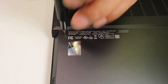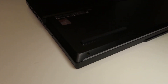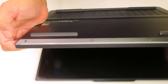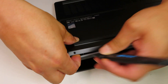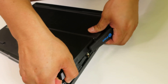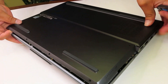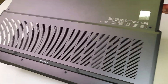Now I'm going to start from the bottom side of the laptop and carefully remove all necessary screws. I didn't see any hidden screws — everything was pretty straightforward, but it was a little bit complicated removing the actual bottom case. As you can see, I'm grabbing one corner and slightly applying pressure to the palm rest just to make a small gap, and then using my pry tool I pull the bottom case and start using my fingers to separate it from the palm rest. Towards the center, you'll need to apply a little bit more pressure on both sides to safely remove the bottom case.